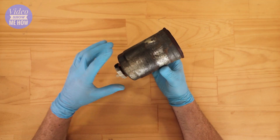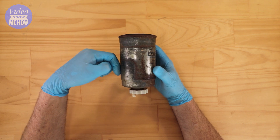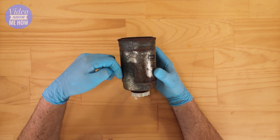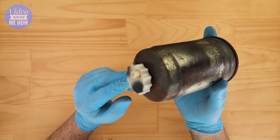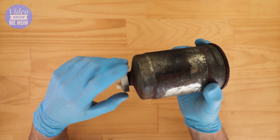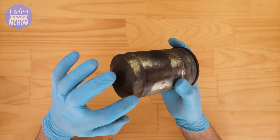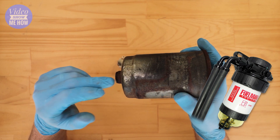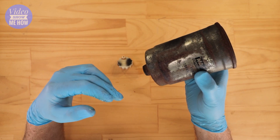The other cool thing with this style of filter is down the bottom there is a water chamber. How that works is: as fuel is pushed down into here, any of the heavier water droplets will run down and collect in this water bowl at the bottom. There is a little screw on the bottom and its function is to drain any of that water out — just a screw mechanism. Sometimes these are clear so you can see if there is water, and if it needs draining you remove the drain tap and out comes any built-up water.